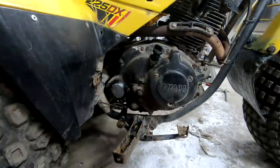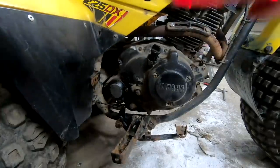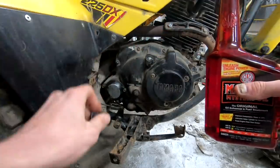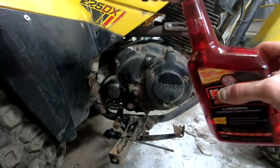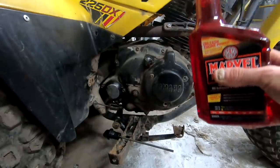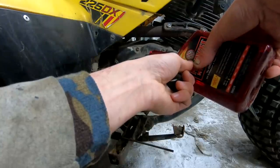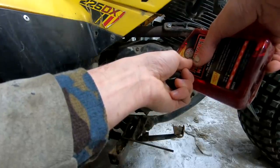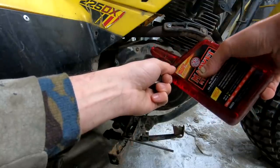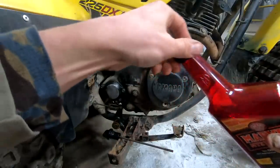So 11.2 fluid ounces. We're currently at — I'd say that's at 30. 30 minus 11 is 19. That's math, right? So we've got to go down to 19 on this guy. That's a lot of freaking fluid. But hey, if it fixes the tick, then that'll be sick. I rhyme for a good time. And we're at 20 ounces — I'm going to call it there. We're supposed to go down to 19.8, but that's good enough for me.